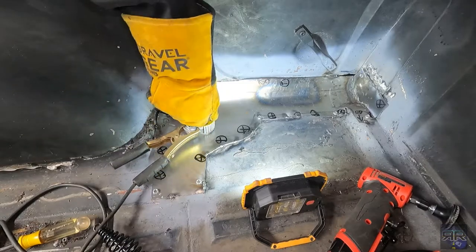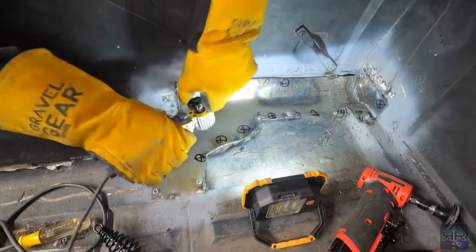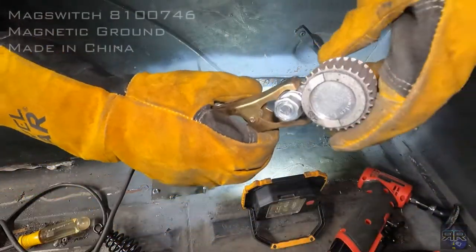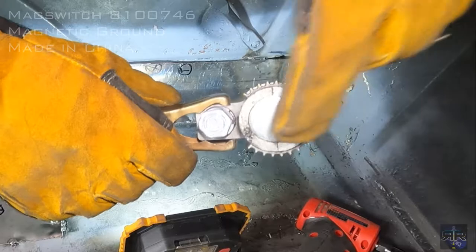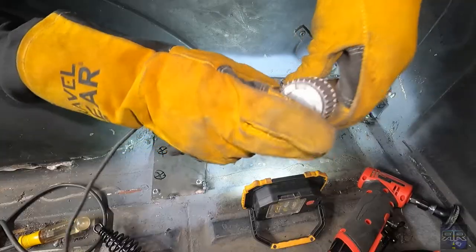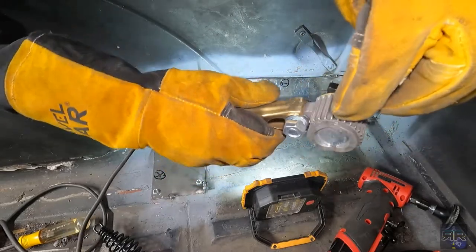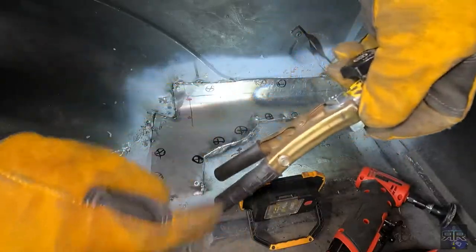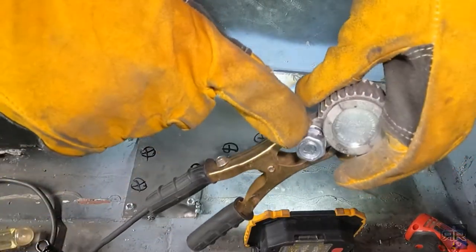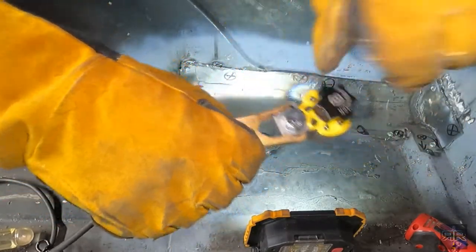My magnet. I ain't gonna lie, this thing is amazing. If you've never seen one of these, there's a magnet plate in there, and as you tighten it, there's actually a magnet inside that gets closer to this. And then once it's on, oh, it holds. But when you pull it by screwing it out, it separates and now you can actually pull it off without a lot of force. Normally, you're supposed to take the cable, hook it into here, but I've noticed it works pretty okay just clamping onto it because there are areas where I want the clamp still.